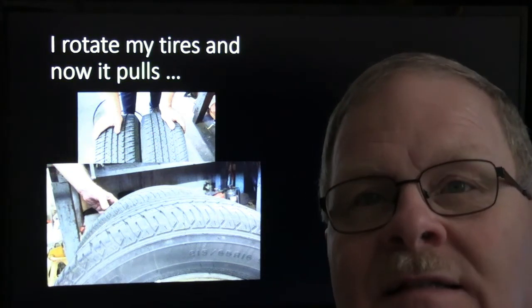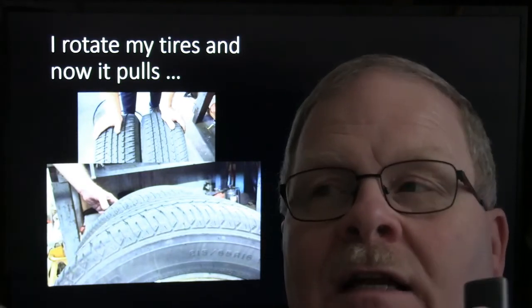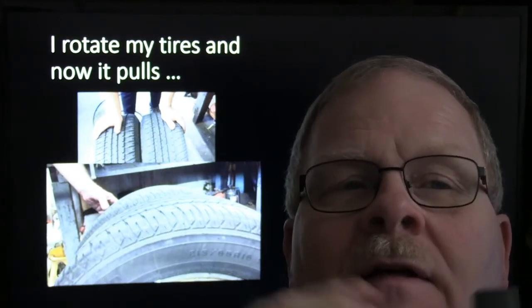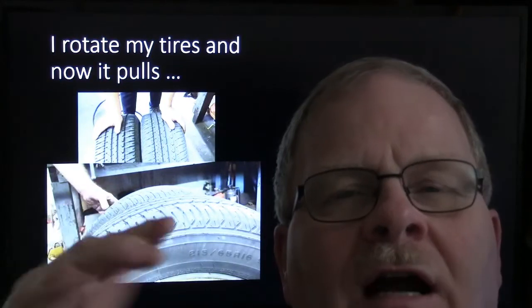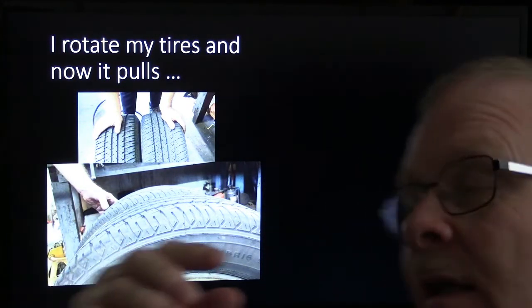You know, I've had to basically put the tires back where they were when somebody would come in and say, I had my tires rotated over at the tire store. Now it sounds really noisy, and you could feel it. The wear that had been from a slight misalignment of the rear tires, you'd have some ripply kind of wear on the back ones, and when you put them on the front, they just get really loud all of a sudden.